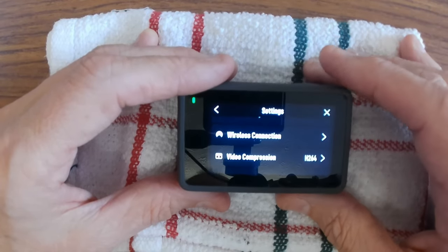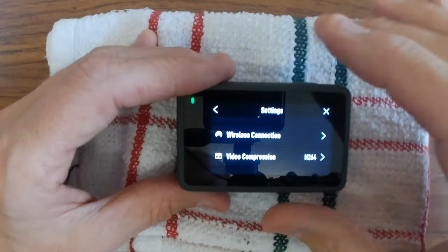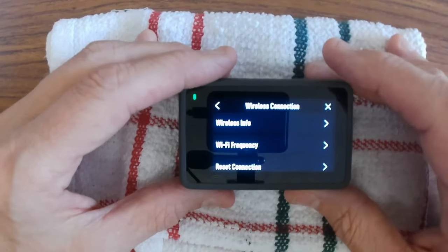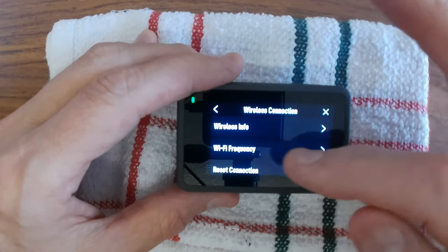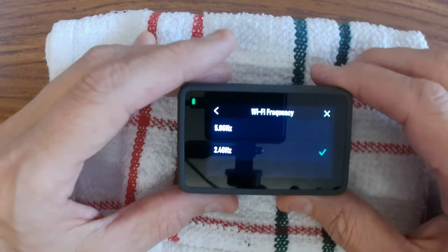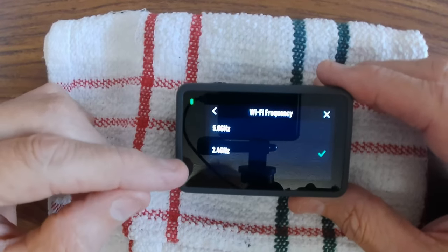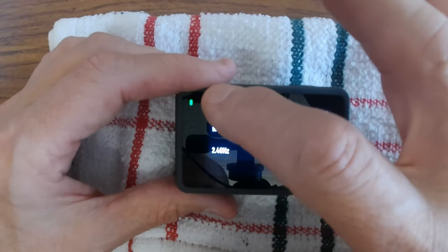Scuba diving mode — I'm never going to use it but it basically tells you about what to do in that mode. Wireless connection — you have to connect to the Mimo app to get software updates. If it just keeps saying it won't connect, go into wireless info, go to your Wi-Fi frequencies, and click on 2.4 GHz. It will be defaulted to 5.8 GHz. If you're using an older phone like I was, it may not handle the 5.8 speed, so switch it to 2.4 GHz and then the Mimo app will work fine.